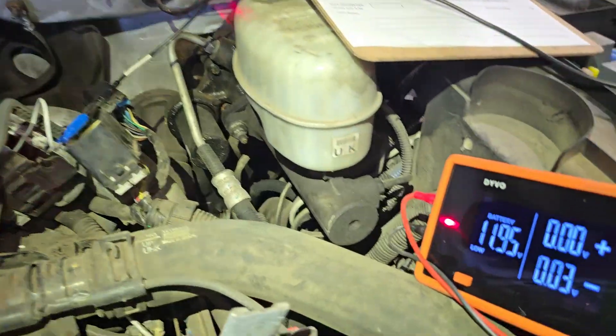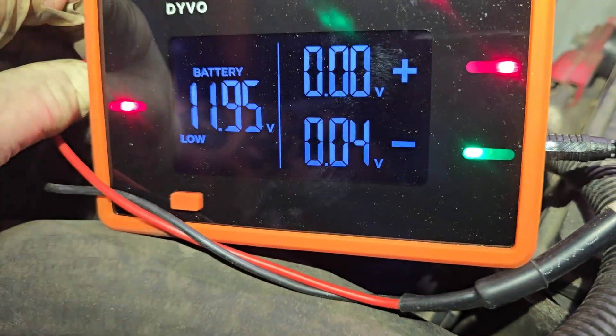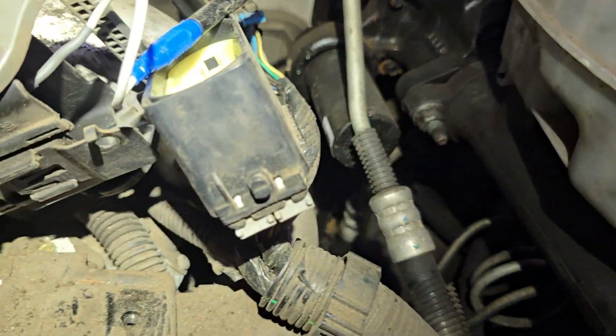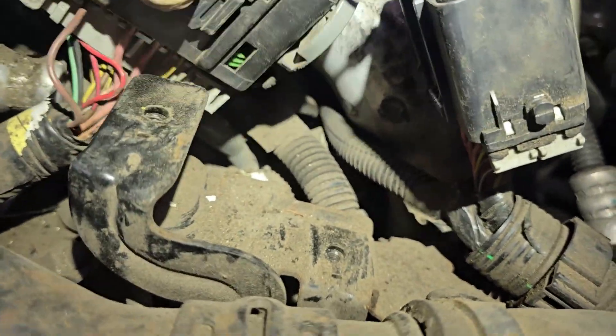Using deductive thinking — the only thing I had done was move the wiring. I was correct: when we had that 4.3 volt loss we had a short, and then all of a sudden we had no voltage loss. So the FICM is controlled by two wires going through this connector — number one and number five.